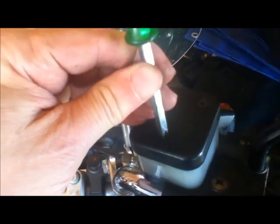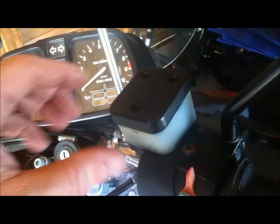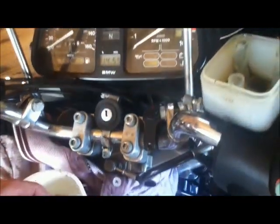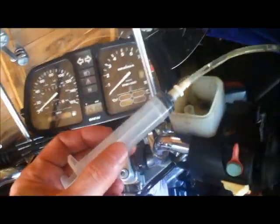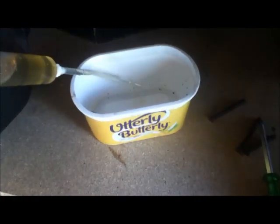I'm going to take the cap off first and then drain all the fluid out with a syringe. This screwdriver fits perfectly. There are two front screws the same length and the back one is slightly shorter. Carefully lift the cap off — underneath there's a concertina covered in oil. I've put a cloth over the paintwork to protect it. The brake fluid is low but very clean. I'll suck out the fluid with a syringe from the bleed kit, and that's as much as came out — going to be thrown away now.